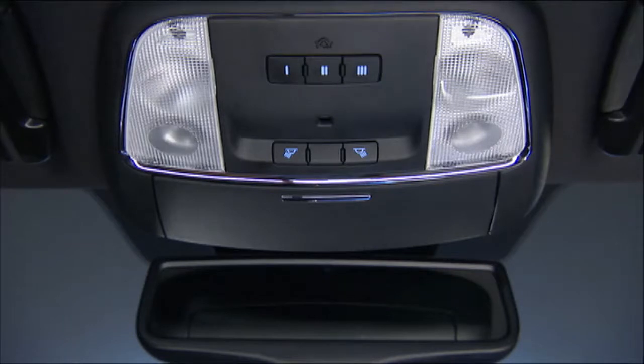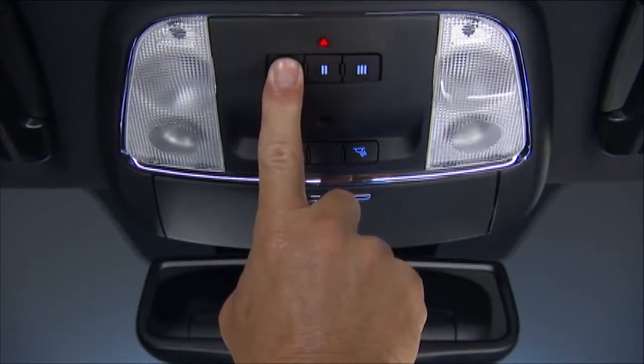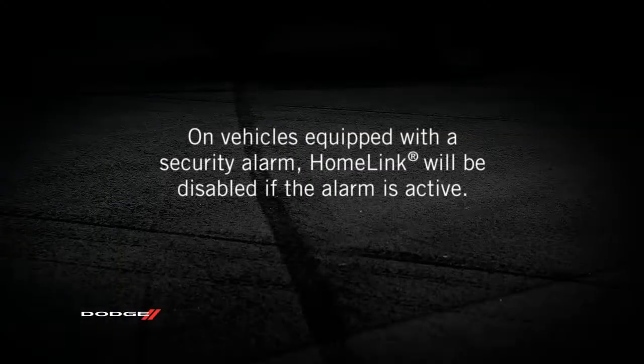When the indicator changes, it is programmed. It may take up to 30 seconds or longer in rare cases. The garage door may open and close during programming. To check your programming, push and hold the just-programmed Homelink button and observe the indicator light. If the indicator light stays on constantly, programming is complete and the garage door or device should activate when the Homelink button is pushed.